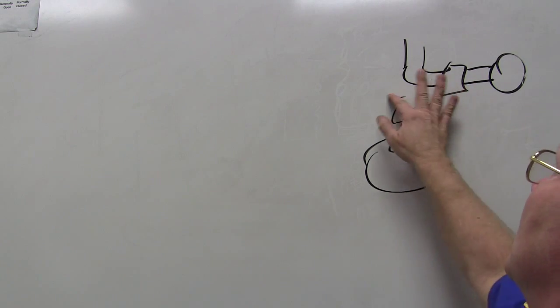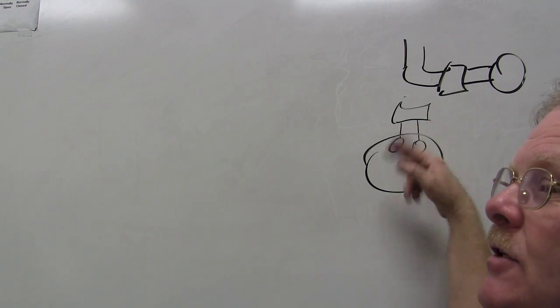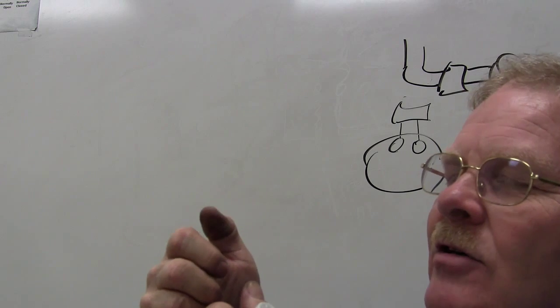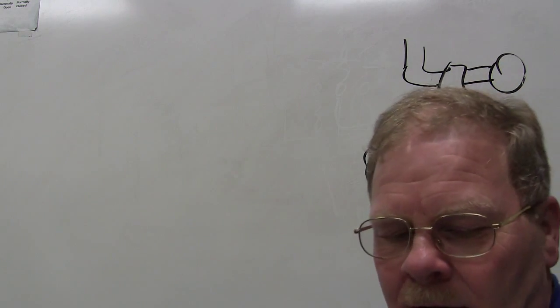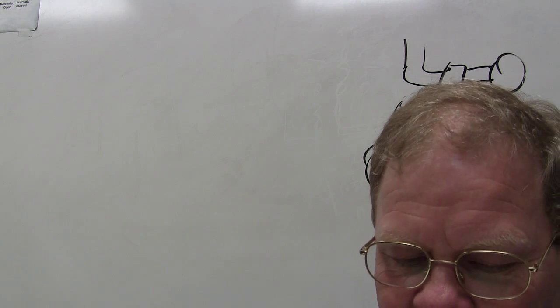Okay. Anyway, power and ground here. The motor should go one way, power and ground the other way, it should go the other way. You can actually check that. You can build yourself a little test box with a rocker switch in it or something, or a couple of relays. All right. So, anyway, on number four, neither one of those guys were right.